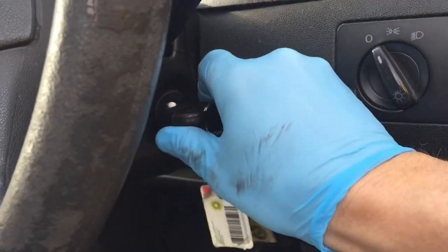If you've got a Skoda Fabia and you turn the ignition key, the lights are coming on the dashboard but it's not actually cranking over - turn the key and there's nothing happening at all, the engine's not rotating and it's not starting. It's a nice simple fix. These particular models - the Volkswagen Polos, the Golfs - they all suffer with the same problem. There's a wire on the top of the starter motor which attaches to the starter motor solenoid, and as the engine moves about all the time it shakes the wire where it goes into the connector plug, and it fractures and breaks off.